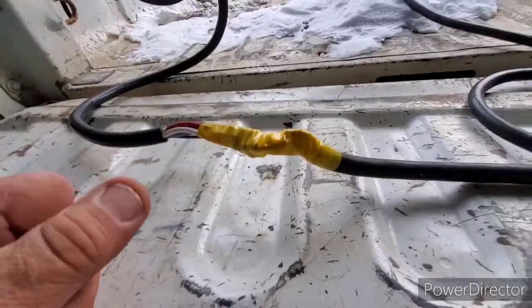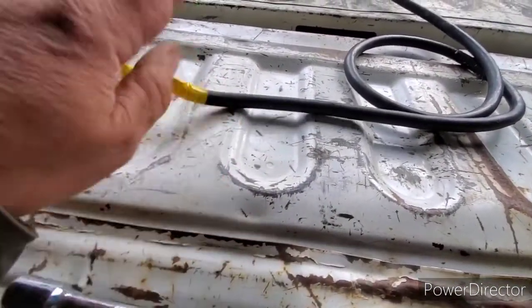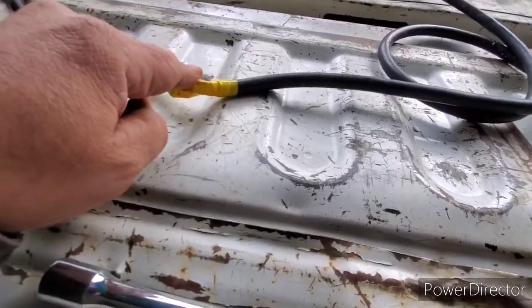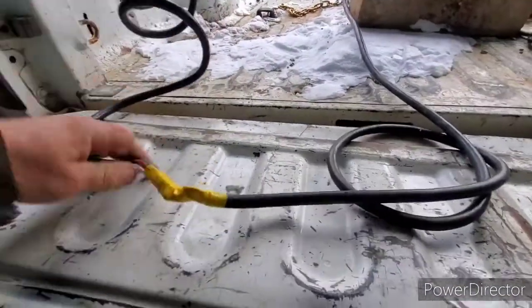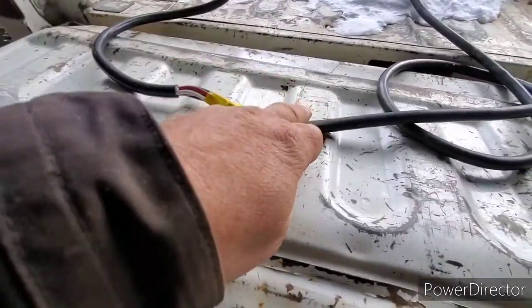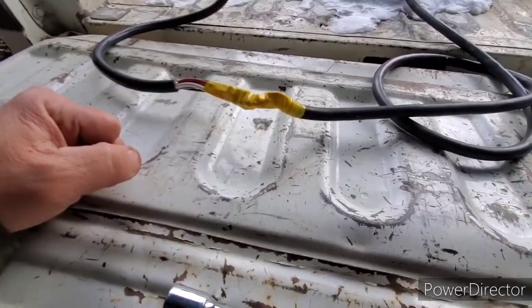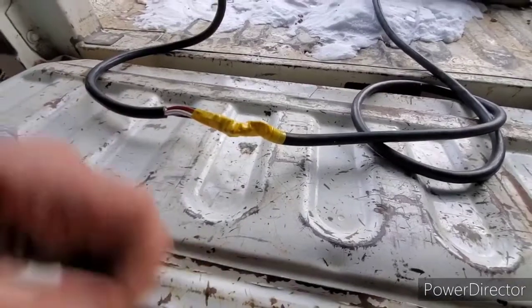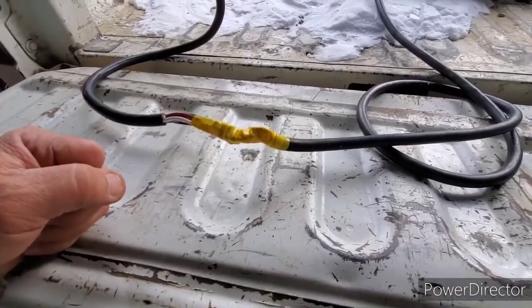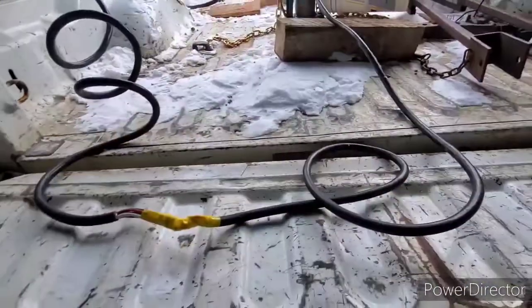Alrighty, so we're backed into the shop here. The plug that was on this cord failed — it wasn't working anymore at all. So I bought a new plug which had a six-foot lead on it and figured we'd just splice the wires together — no problem, right? Not so much, because now when I hit the brake all the lights come on, when you turn the marker lights on none of them come on, and when you turn the right-hand signal light on all the lights start lighting up.